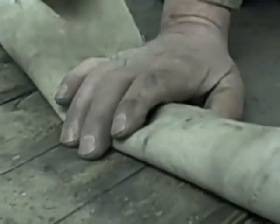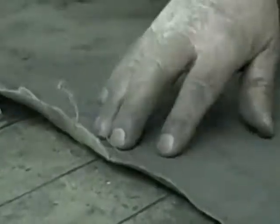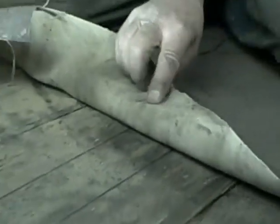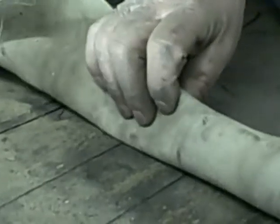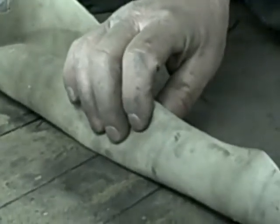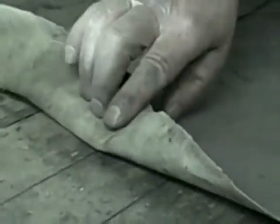This is no good as you can see and we're going to tear that off. We are doing something different now because our cars sit so long outside. We're going to use a stain which is a thinner paint and it will soak through so that they will not have a raw underside. This canvas didn't rot but we have had trouble with water getting in and rotting the canvas because the other side is unprotected.